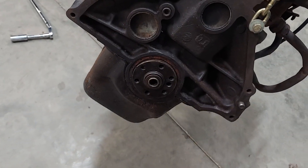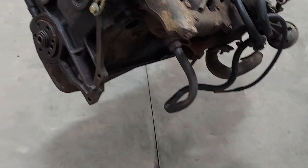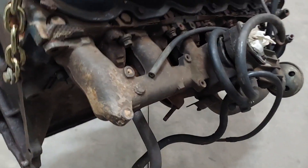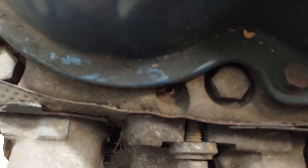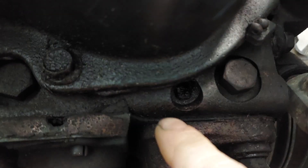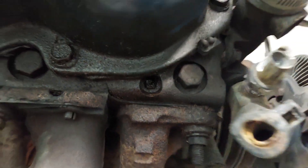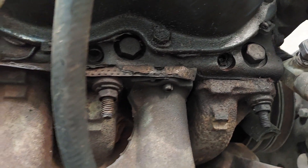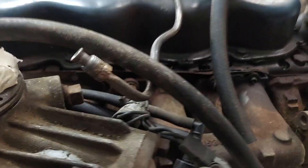If you can get to it while you've got it out, knock a rear main seal in it, because you don't know how long that's going to last or if it's been dry rotted. Also, I noticed if you start looking in here, some of the emission plugs right in here have been deleted. That's a good thing — when I see that emission stuff gone, that means someone else has been in here, could have been rebuilt at some point, because usually people don't do that unless they have the motor out. Those are plugged off, so that's a good thing.